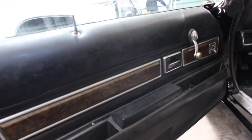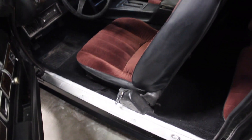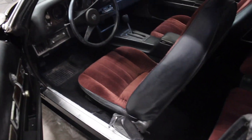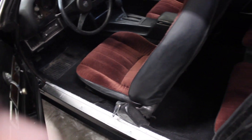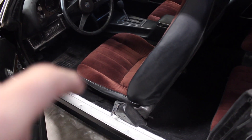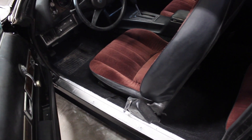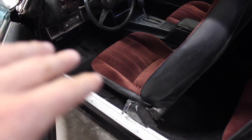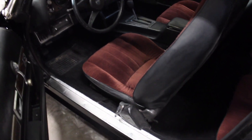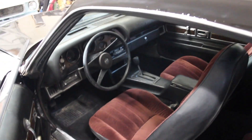I mean, this stuff is pretty old — I believe it's original — so it'll probably need a few more rounds of Armor All. I got the slide function on the seat to work again. I didn't film anything; it was pretty straightforward. Just fully tipped it upside down, spread it with a bunch of penetrating fluid, and then worked some marine grease inside it, stuck it back in, bolted it on, and pushed back and forth to slide the grease around, and that got it moving.